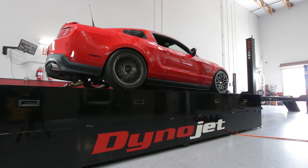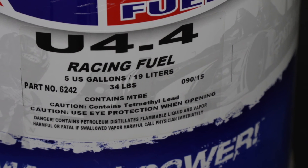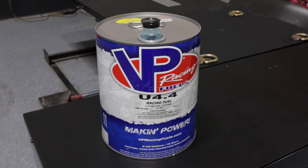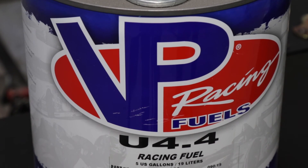Here are a couple of tips to help you get the most out of your air fuel ratio module. Leaded race fuel will drastically shorten the life of the oxygen sensors, and two-stroke engines will also lead to shorter sensor life. If you tune these kinds of vehicles, have replacement sensors on hand.